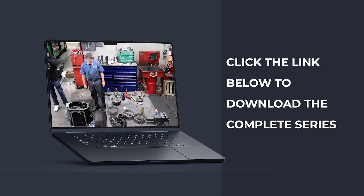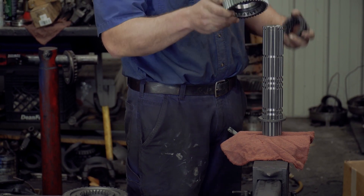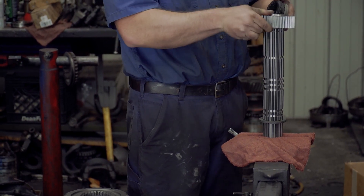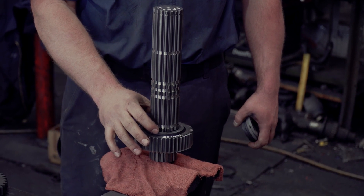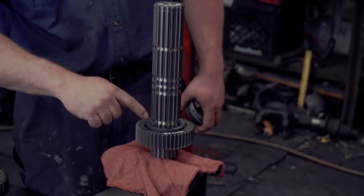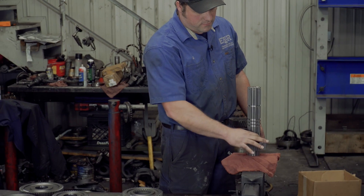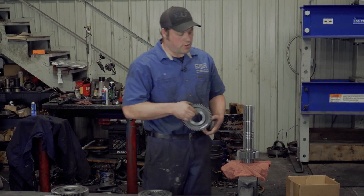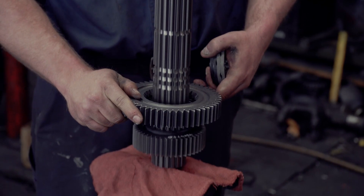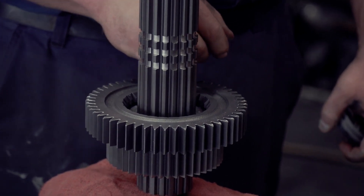Now let's assemble it and see how it goes. We'll start with one washer, slide it down, put a gear on. This is fifth gear and it's going to rotate this way, straight down. Washer, 4302-258. You're turning this and lining this stuff up where this keyway can slip down just like that — it locks this washer into place. Third gear facing upwards.